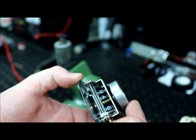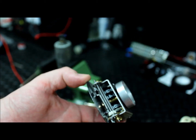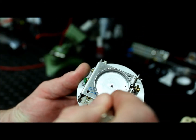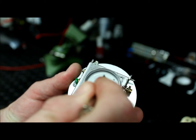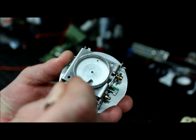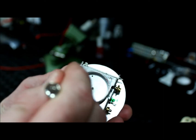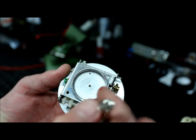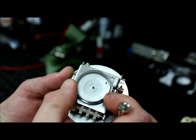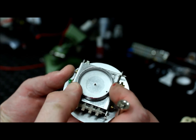The hair spring inside here obviously needs to be calibrated quite accurately — doing what I'm doing there now is decalibrating the instrument. Here's the drag cup assembly. All it is is an aluminium cup with a hair spring, and that hair spring allows the cup to return back to the zero position. As a magnet rotates, it creates eddy currents, and those currents created inside that cup try to rotate and catch up with the magnet. Obviously the faster the magnet spins, the more currents are produced and the more that cup will turn.